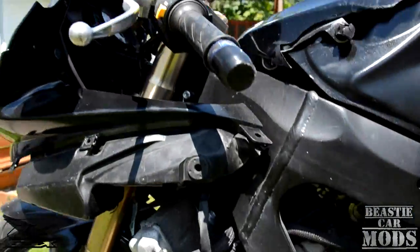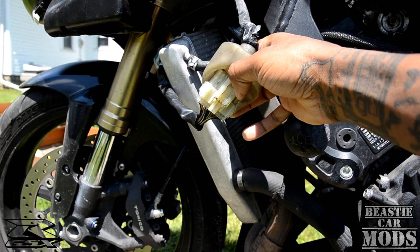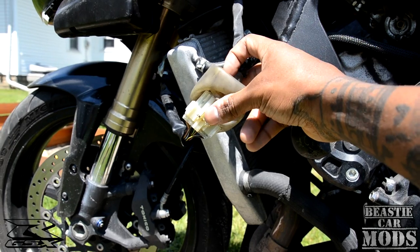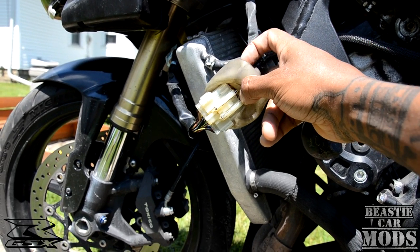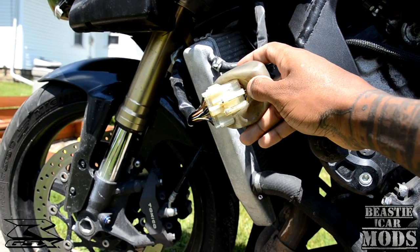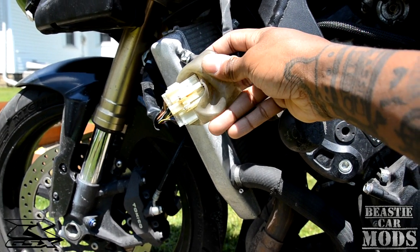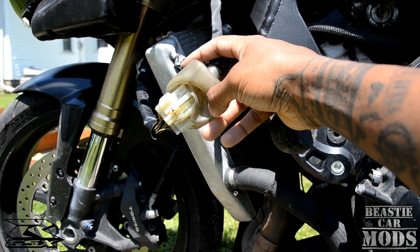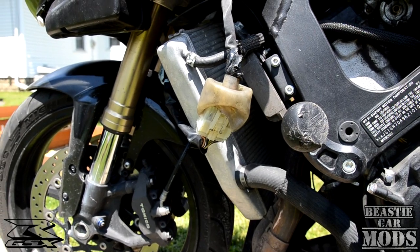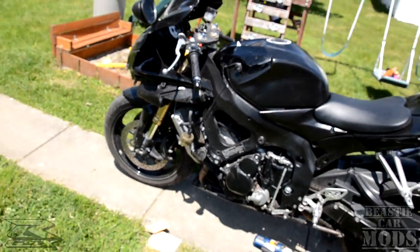Pretty much all I'm going to do is fix this connector right here — fix that burnt out wire. A couple of solutions: you could just replace it, take the wire out and put another pin inside because it was too loose, or you could just splice the two wires and bypass the harness. That's the problem right there for anybody else having this issue. Hope this video helped — leave a like, comment, subscribe if you haven't. Thank you for tuning in.